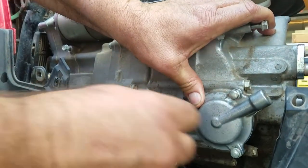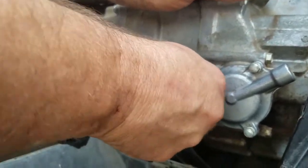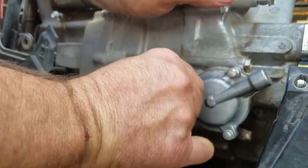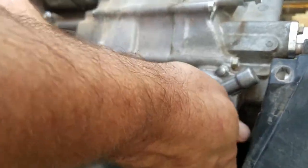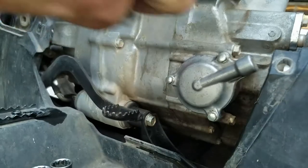And so I'm going to upload this video for you on your oil change so you always know. And by the way, the bolt underneath, the size to drain your oil is a number 17. To drain your oil plug that's directly underneath. It's in that hole. And then these are number 8. So we'll just screw them on here with this. We got it. New filter. We're just gonna snug these up because it has a seal and we don't need to mess with the seal.